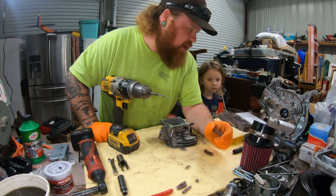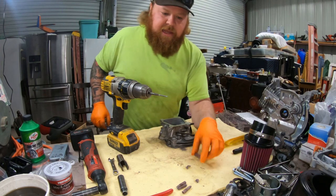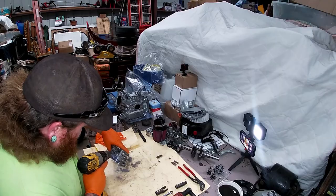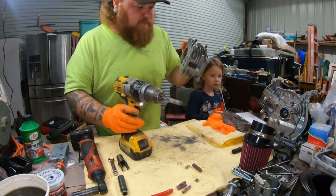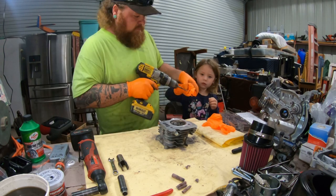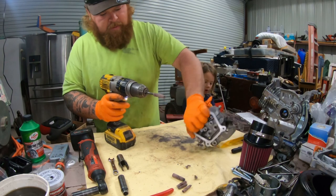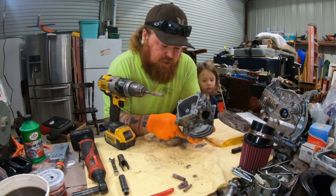The size we were using just a second ago - those were 80 grit. Now we're going to bump it up to 120, smooth everything out, clean it up, and I've got some aluminum polish to try to polish some of that aluminum out. Now with 120 grit, you'll be able to tell the spots on the head that are still where the 80 grit was, and then where the 120 has smoothed it out.